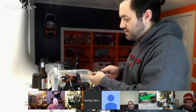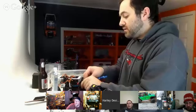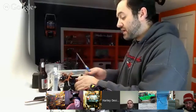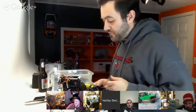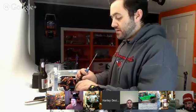No surprises yet. So is that kit that you're putting on now similar to the one you put on the Deadbolt, the Toyzuki? No, this one is very different. This one moves the entire transmission forward, where that Toyzuki only moved the spur and pinion forward. Oh, gotcha. Do you have to get longer drive shafts? Yeah, you technically do. I've got the MIP drive shafts for this. I've installed them, and the front one so far seems to fit. And in the rear, I'm actually going to do a shorter wheelbase. So you can still use the drive shafts then? I should be able to, and if not, I can just swap in longer MIP drive shaft parts. Gotcha. That's the current plan anyway.